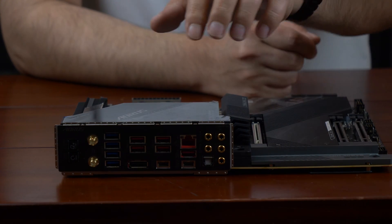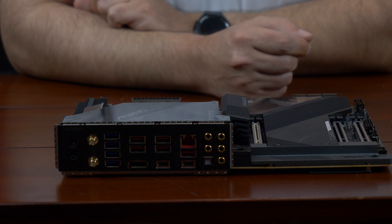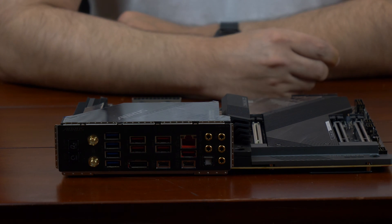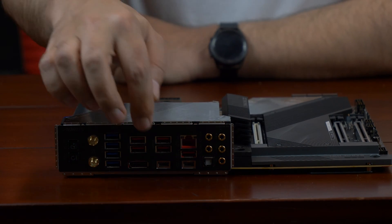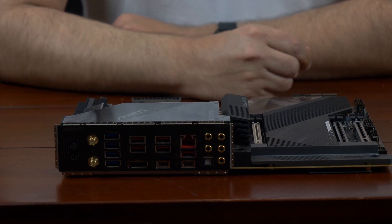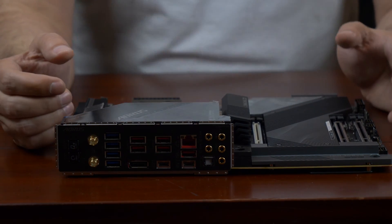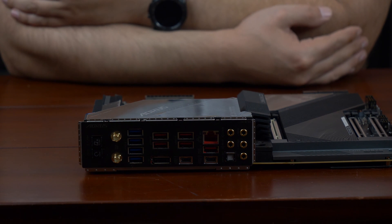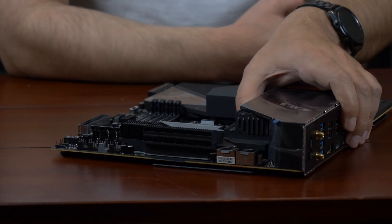That 20 Gbps port and the internal Type-C connector are the only two ports on this motherboard that do that. The other Type-C connector right next to it is basically USB 3.2 Gen 2 — not 2x2 — so it only has one link, meaning it's 10 gigabits per second. All the red USB 3.2 ports you see here are USB 3.2 Gen 2 ports, all 10 gigabits per second, including that one USB Type-C. Then you have four blue ports — those used to be called USB 3.0, they're 5 gigabits per second, now called USB 3.2 Gen 1. There's also a single DisplayPort because the CPUs for this motherboard, unless it's a KF or F model, come with integrated graphics.